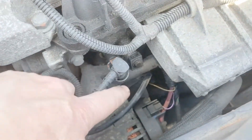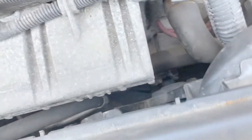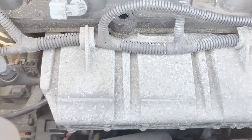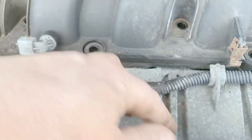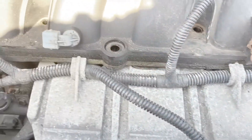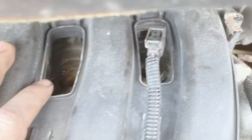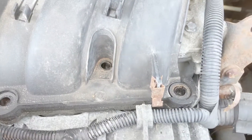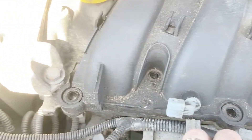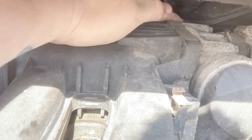You can see this is the fuel line going into the fuel rail, but I can't actually see any of the injectors because this — whatever it is — is in the way. Can't even tell what it's supposed to do. I've got a feeling that's going to have to come off. I feel this manifold might have to come off first. I've started taking the bolts out, disconnected the coils and removed those. Once the manifold's off I'll probably pop the plugs out as well and give them a clean. There are five bolts along the front and I found another one on each side — you can't see them but you can feel around for the bolt heads.